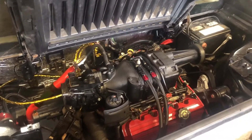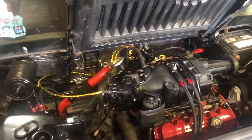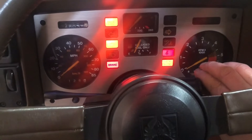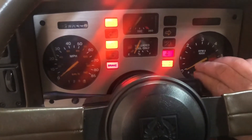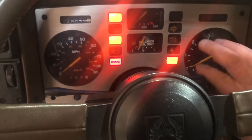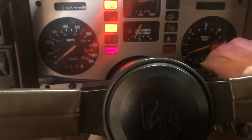I've got to wrap the harness, battery's installed, cooling system's done and bled, and I've got it to where it will start and run. Full disclosure though — I tried to start the car and it cranks but it won't fire. Turns out the ground cable was loose and I shorted out the ignition module. The new one should be here sometime this week, so in the next video you can hear this thing run. I've also finished the exhaust since then, so I'll see you guys on the next one.